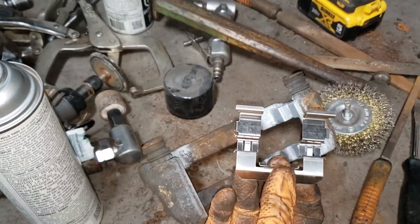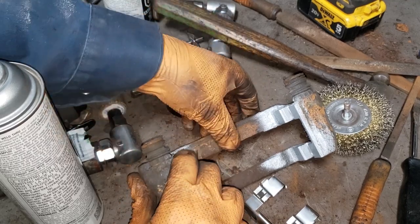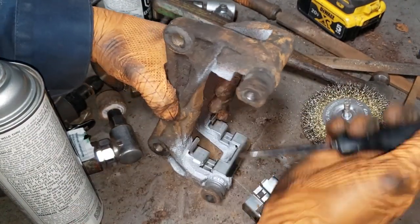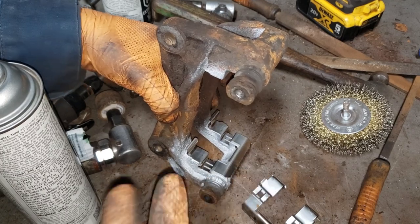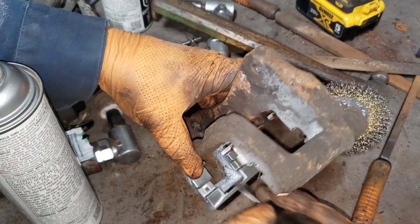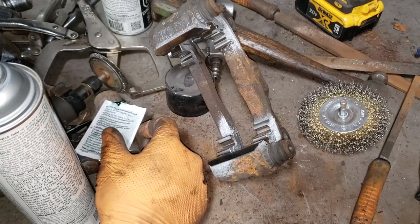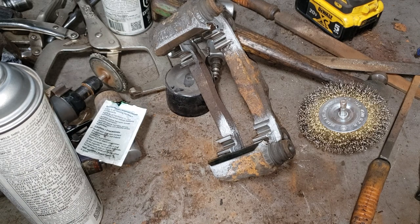Compare to make sure the clips are the same. Once you are 100% sure, force your clip into place. There are two places where the clips latch — up here and in here. Up here can be a pain in the ass. Make sure you force it into the corner and also push it down so that the backing portion is towards the caliper bracket. Make sure it ain't going to come apart easily and you're good to go. Always double-check to make sure it ain't loose. Get yourself a good quality brake grease — this stuff here that comes with the Bosch pads is pretty good. Go ahead, grease those guys up and we'll talk about the sliders.